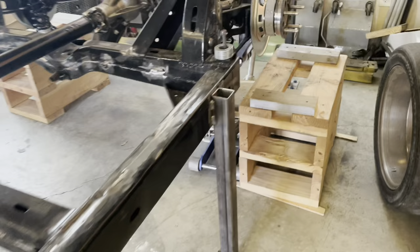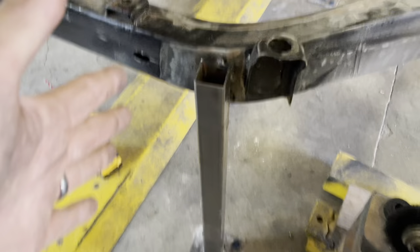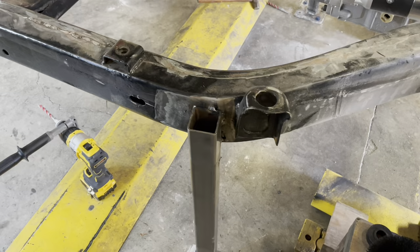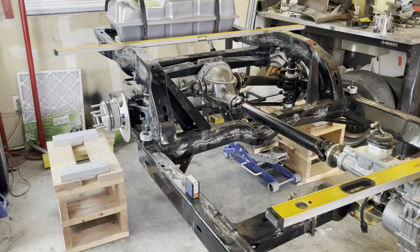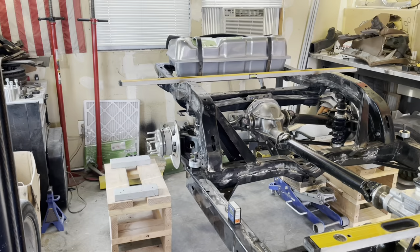Driver's side is where everything is supposed to be. The passenger side has a front and a quarter brace between one and two. Wheels are off, and I've rechecked — the frame came down about an eighth inch just by removing the tire, the wheel. So I'm going to overcompensate.